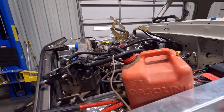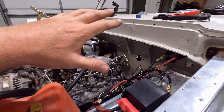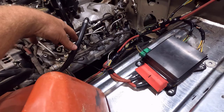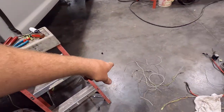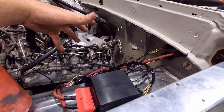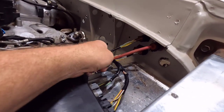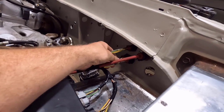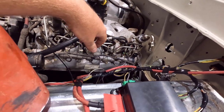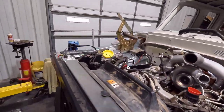I think I have the majority of the wiring harness all sorted out under the hood. The big thing I did was clean up all the extra wire at the battery junction box — there was about 24 inches of extra wire on all the wires that went through here. I repinned the connectors into the battery junction box and also pinned them into the bulkhead fittings through the firewall. I got the lengths all sorted out and got the harness taped together, getting it ready to re-loom. I'm glad to have that all sorted out and cleaned up.